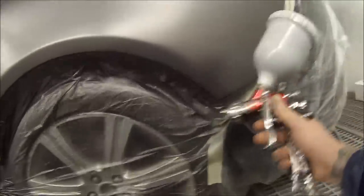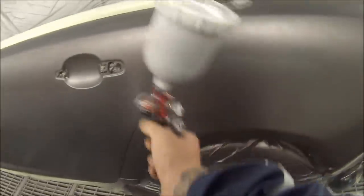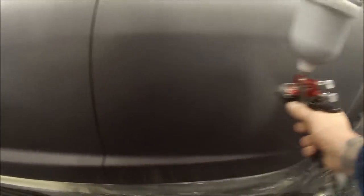I've given that first coat approximately three or four minutes to dry off in between coats. You can tell when it's dry — it's no longer shiny, it'll eggshell using a solvent-based coat. On with your next coat, you want to start getting your coverage up. Put it on a touch wetter than your first coat, and after you've got this coverage coat on, you'll then put your blending clear over the blends and then your tech coat or technique coat.